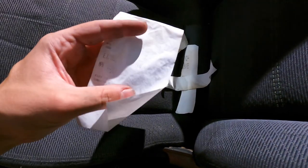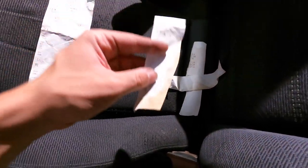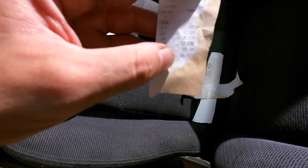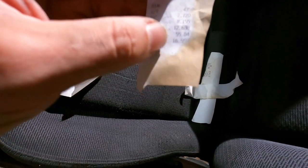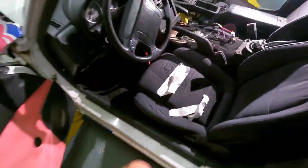While getting the shifter pulled, I found some old time slips from when they ran this Miata. This one shows it went 23.6 at 59 miles an hour. The rest are faded, but one looks like a sub-20 second pass — 16.5 seconds to the thousand. I think we're going to make her a little quicker. Going deeper than a 20-second pass shouldn't be too big of an issue. Hopefully it should be able to run a bottom 14 or high 13-second pass with a tuned all-motor K-series.